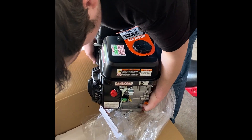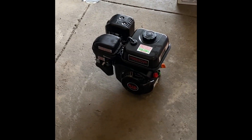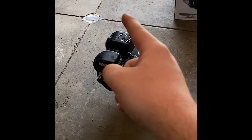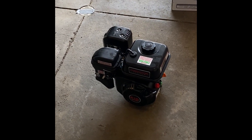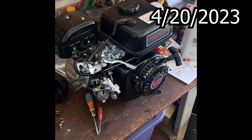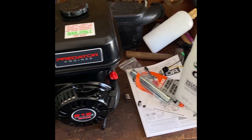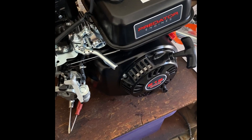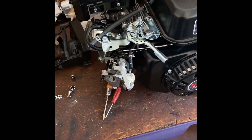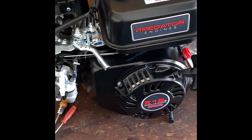Smells like fresh engine. I'm going to do a lot to this thing — obviously it won't fit in there at its current state. I'm going to remove the fuel tank, the old air filter, and get a custom exhaust, probably one of those kits off Go Power Sports. I'll use the tank that's already in the four-wheeler since I did clean that out. Today we're getting this thing running. Got some Castrol GTX 10W30 with sludge protection. Got five quarts — you need two or three oil changes for the break-in period. I'm going to get the air cleaner back on and run this thing completely stock to break it in, then get down and dirty with upgrades.